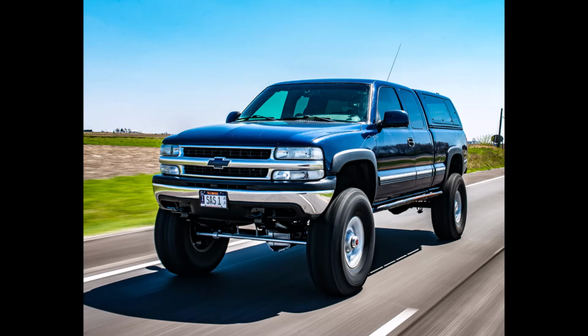Like I said, I got a brand new set of 38.5s on there. I'm going to run those. We're going to see what breaks. I've got chromoly axle shafts in the front now, and I didn't have those before. And I'll probably be putting chromoly in the 9-inch here pretty soon, because that was the thing. I blew up the Yukon on one trip. I broke something internally on it, and then Randy's Ring and Pinion was cool. I called them up. They said it was out of warranty, but I could ship it back to them. I shipped it back to them. They rebuilt it for half the price of a new one. I was like, well, I'll either buy a new one or buy this one for half price. So they fixed it, and turnaround time was probably 7 to 10 days from the time it got there to the time it got shipped back out. It wasn't bad. They had it turned around pretty quick.